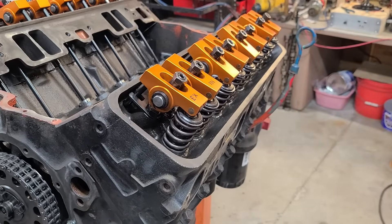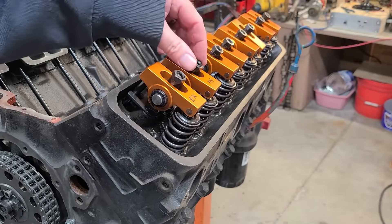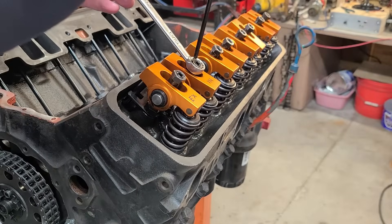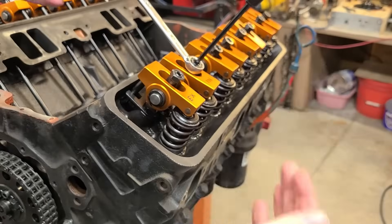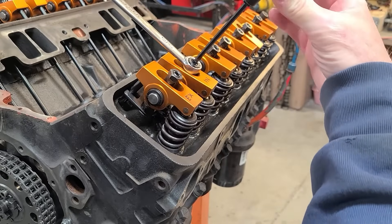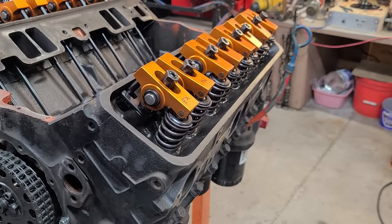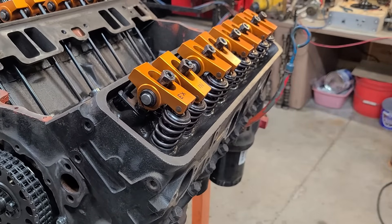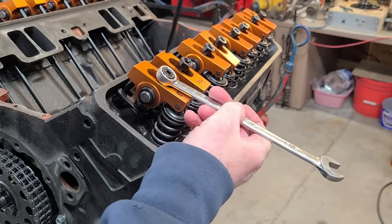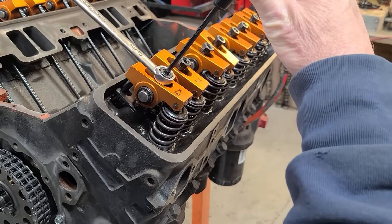We're both at zero right now — we're going to go a half a turn preload, but let's see where we are first. Spin this thing around. The exhaust valve started opening — EOIC, Exhaust Open, adjust the Intake. Zero lash right there, then I usually go a half a turn. Lock the lock nut or set screw down, back the nut off a little while keeping pressure on the set screw, then bump them at the same time — that locks it down. EOIC — intake is adjusted. Now spin this around and watch the intake rocker open all the way and start to close. It's almost closed — now adjust the exhaust rocker, go a half a turn preload, lock the set screw, back off, bump together — it locks.